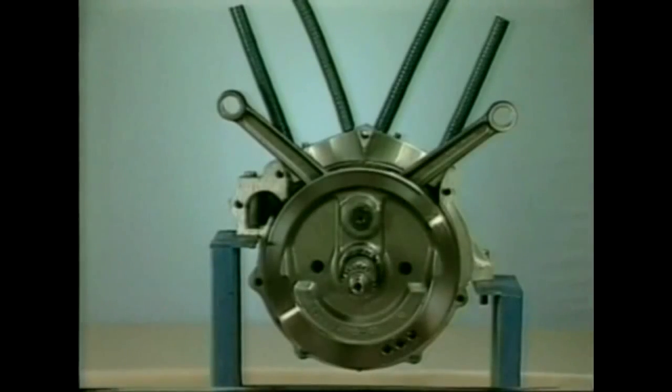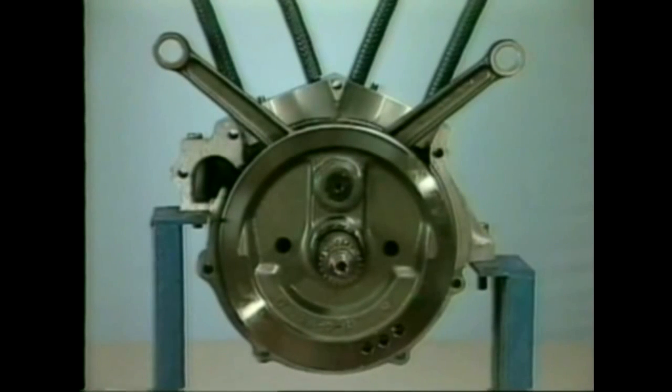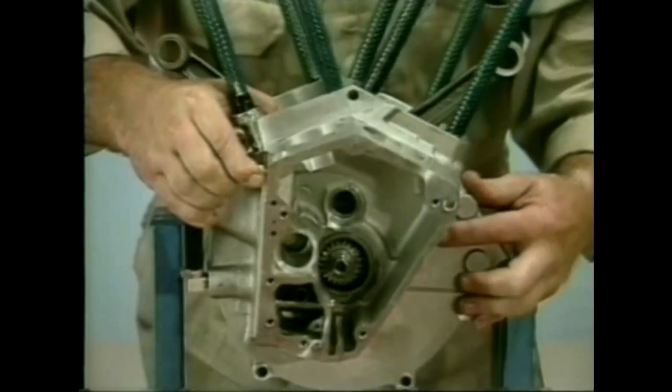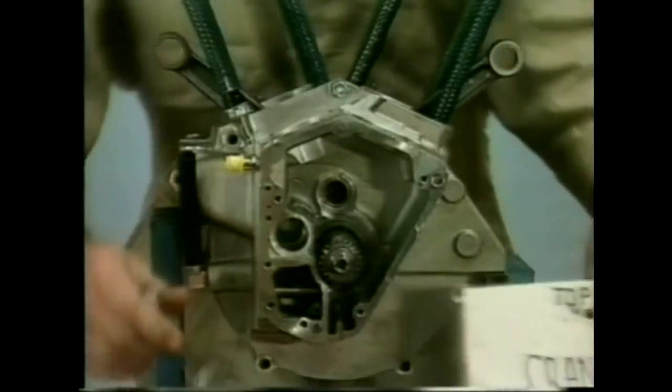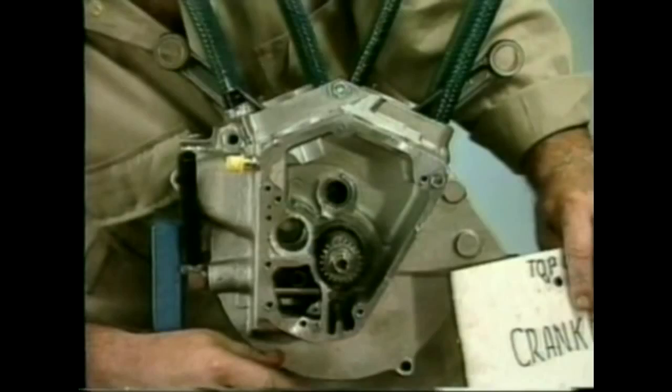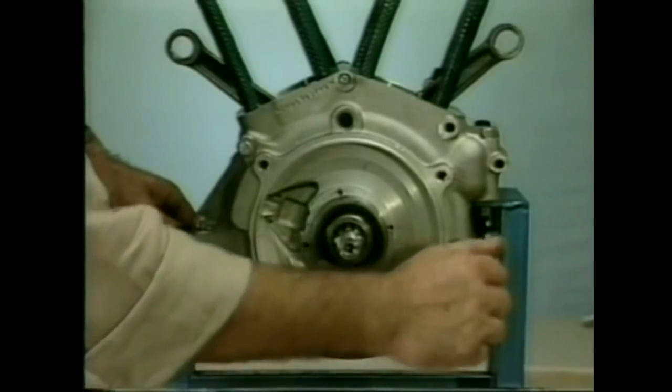We have now completed the disassembly of our Evo motor. We must now clean thoroughly all the parts, paying particular attention to gasket surfaces. Before putting the crankcase back together, we must oil all bearings and their surfaces, clean the mating surfaces, and use a good quality sealant as there is no gasket between the two crankcases. Carefully slip the right side of the crankcase over the pinion shaft. Taking the three studs we placed in our reference card earlier, we insert them into their corresponding holes. Observing from the primary side, these two bolts along with all other studs are tightened with a torque wrench to 18 foot-pounds.